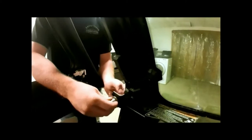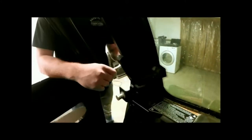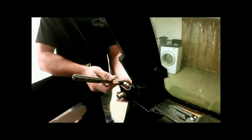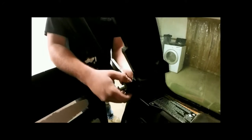Alright, take it off. So we know we're going to slide our bolt inward, and we'll take our 11/16 and our 3/4, and we'll go ahead and tighten those down. Now we're a little loose on our adjustment up and down, so we'll take our star bit once more and go ahead and find center, and we'll tighten it down as well. Now we'll test it out. Looks like we're hitting a little low, so we'll come here, loosen, and we'll drop our bolt, our whole striker plate, lower.